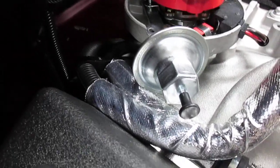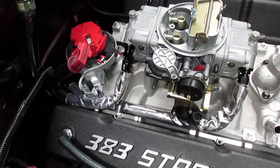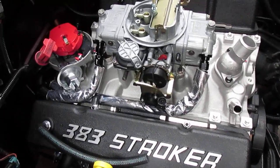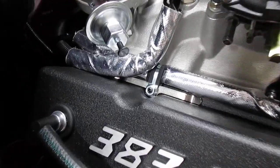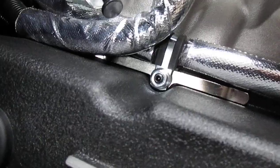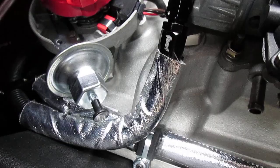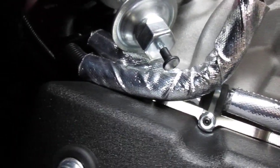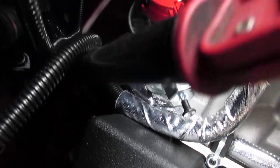I've used several of those hose separators here, and I've actually fueled my carburetor from the rear instead of the front because I am using the in-tank fuel pump. The hose is clamped behind the stud holding the valve cover on, and then the other hose to the rear bowl comes in side by side with another hose separator below.